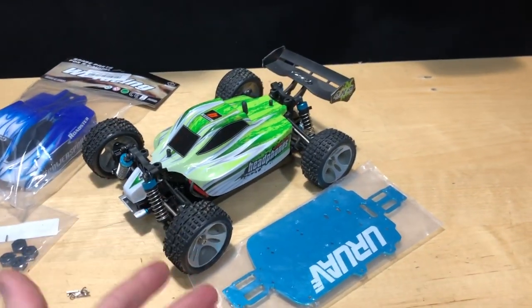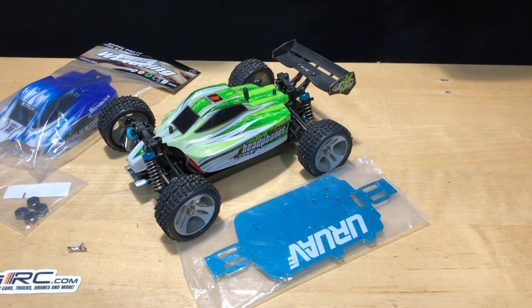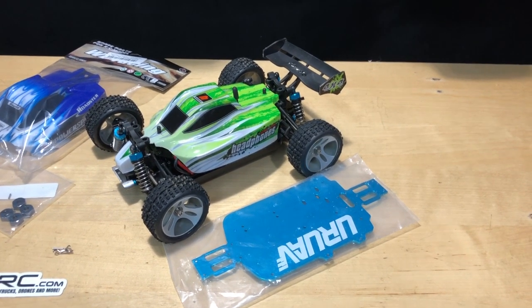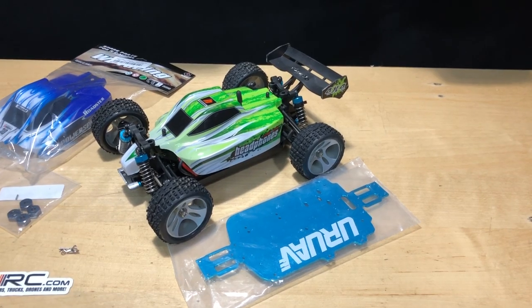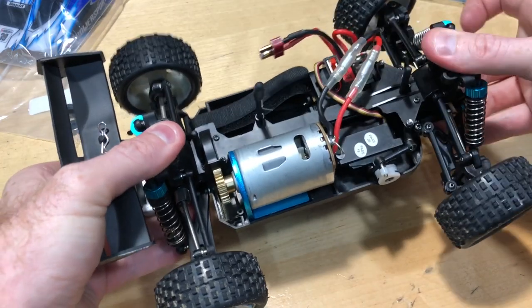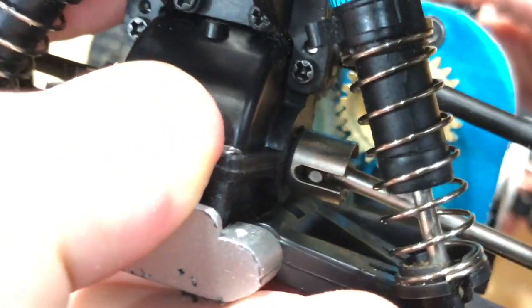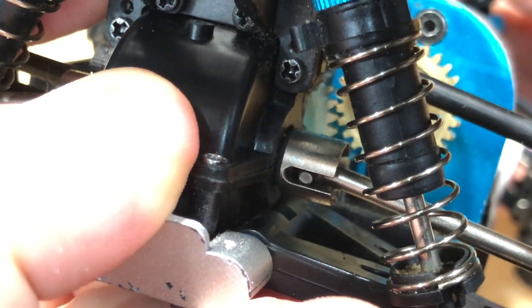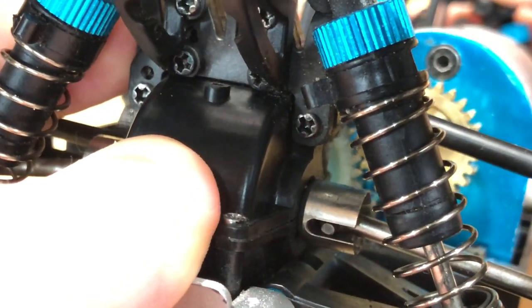The main focus is why I went with this aluminum chassis. I know some of you chimed in saying you need to upgrade to a metal spur gear, and I'll show you why you probably said that — but also why you don't need it. If I just twist this thing, you can see I'm not putting a lot of pressure on it. But if it twists one direction the gear mesh is too tight, and the other direction it gets super loose.